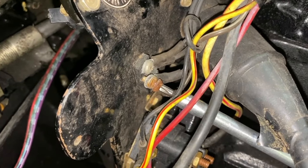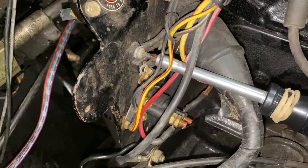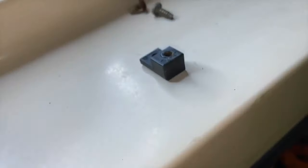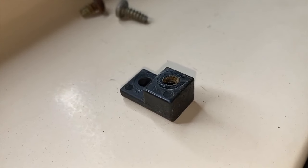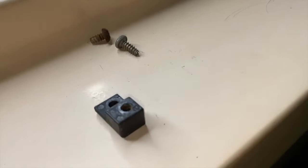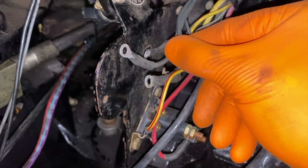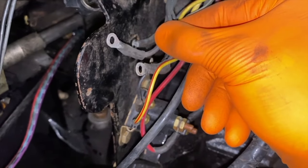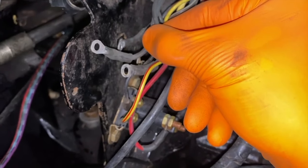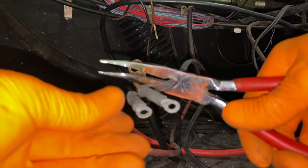The starboard side wiring feeds into those two screws and mounting points — I'm going to carefully unscrew those. Take photos or video to ensure you know how to re-secure the new wiring. Bottom screw is now removed. The part that goes on — make sure you don't drop that in the engine. The bulky block portion will be on the bottom and the screw goes into that bulky block bottom portion. Both wire connections — one on the top screw, one on the bottom screw — were the first connections on the mount. I'm now going to cut those connection parts off.